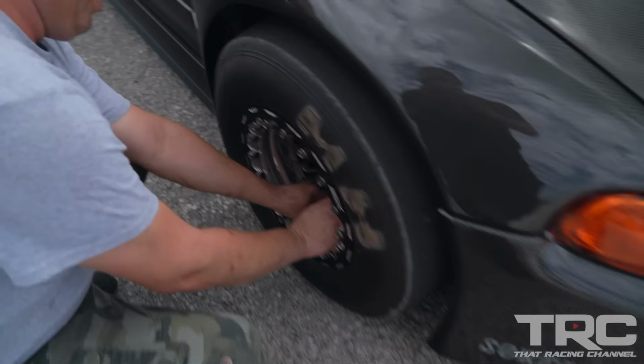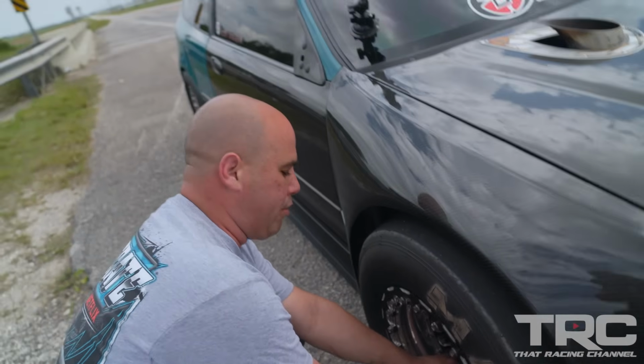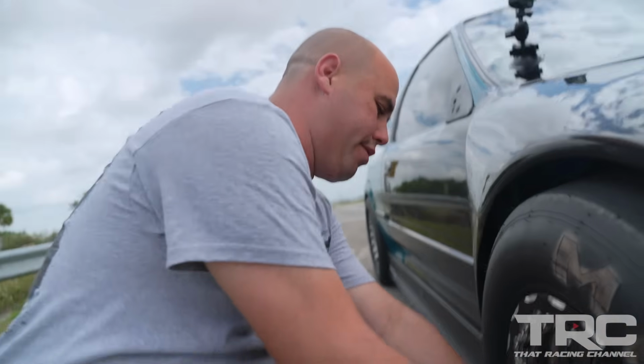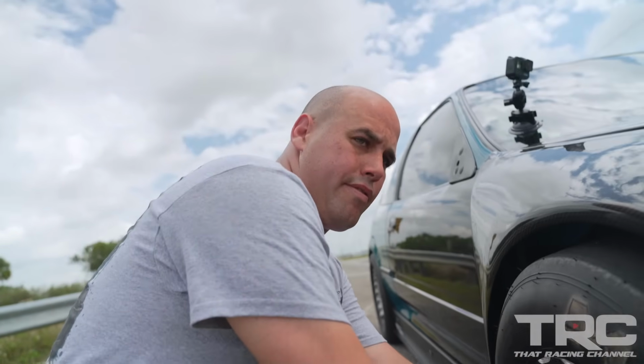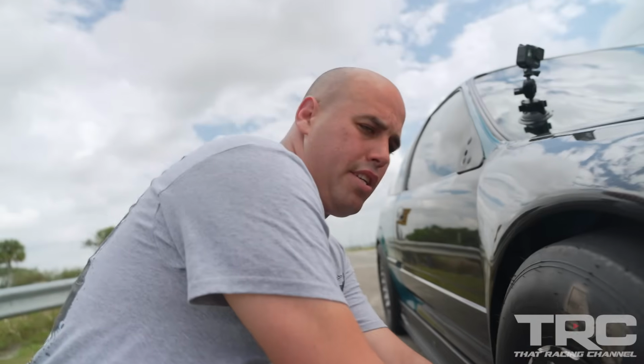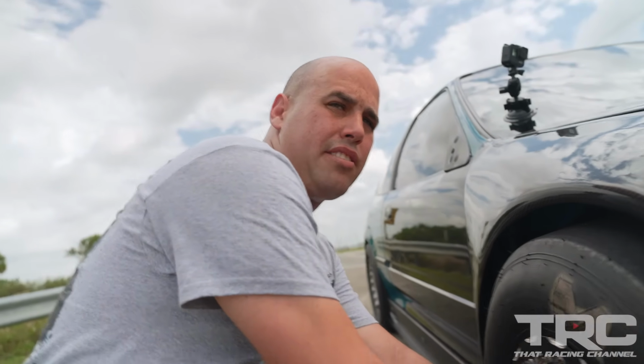Lower the pressure to what you said, 8 pounds PSI? Now 8 PSI, for the dig? 12 in the back, so see if we can get a good launch over there. So let me ask you, at this horsepower level, do these blocks like to survive, or where do you start seeing issues? Over 1300, the block cracks. Like the head gasket. It's like rolling the dice?